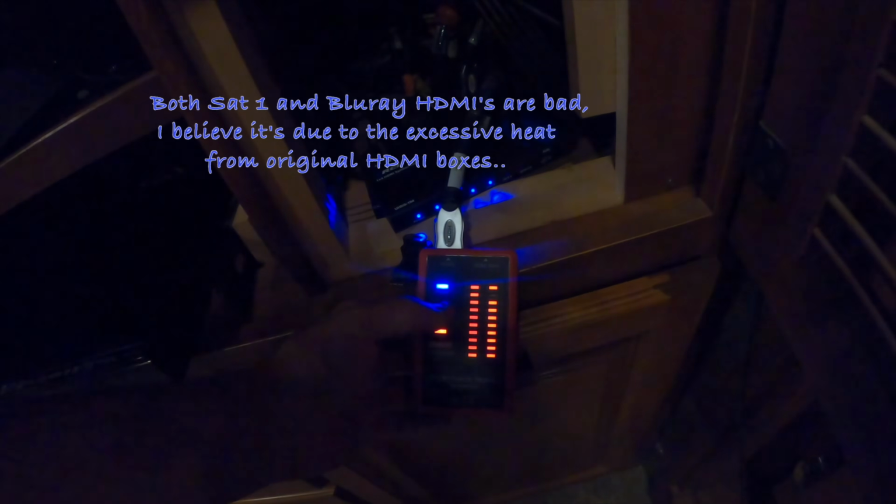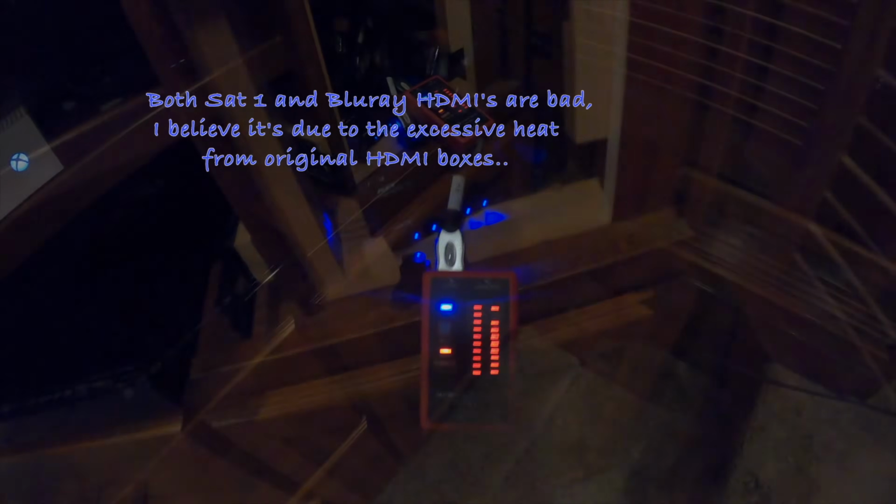So I hooked up my tester, and when you see it come back to this number 2 over here, it's blank. Which means the cable's bad. Got a cut in the cable or a dead wire. See how that one's out? So I'm going to go try the other one because apparently both of them are bad. So let me go hook that up and I'll be right back.